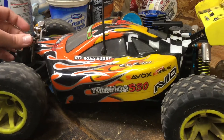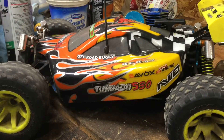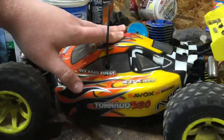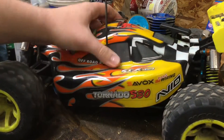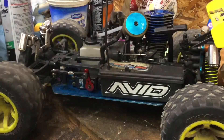So today I thought I would get it running and maybe drive it. But the main thing is I can't really get it started because the one-way bearing's slipping. It's not gripping all the time, so it's going to be a pain to start. Let's work on that first.